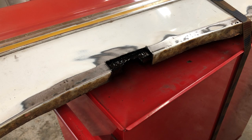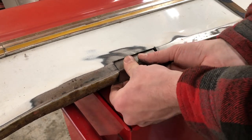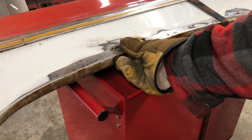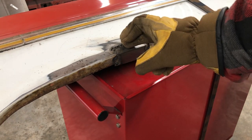I have a couple coats of rust reformer — or rust converter, whatever you want to call it — on the inner part of the fender. And I'll say it now: don't do what I'm doing. Fix it correctly. Cut all of the inner fender out, spend the time, do it right. But this is not a showroom truck or a frame-off restoration. So I'm just going to fit my patch panel in after this dries a little bit, grab my welder, and zap this into place. Once again, not the prettiest, but it's solid, it's not going anywhere, and it's a lot better than the rust hole that was there.